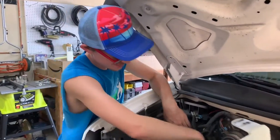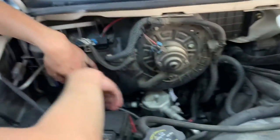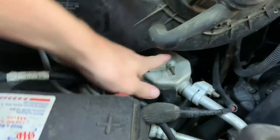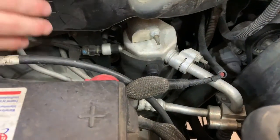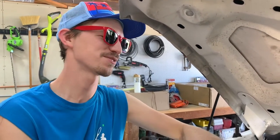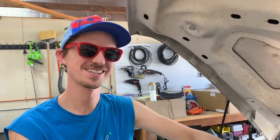Right here on the accumulator, you need to figure out which lines are going to the back and which lines are going to the front. It'll have one pressure and return going to the front, one pressure and return going to the back. I believe this top one's going to the back. Just need to verify — all of your front heating, ventilation, and cooling is done inside of this box right here on the passenger side. We already went to the shop and had the system evacuated so that you don't leak the freon into the ozone.